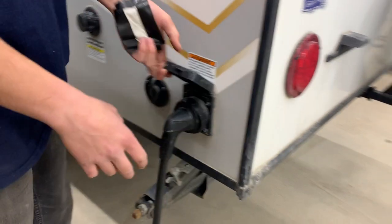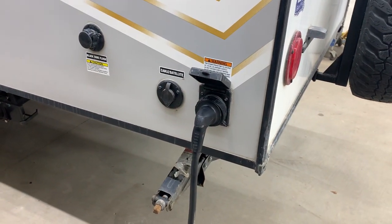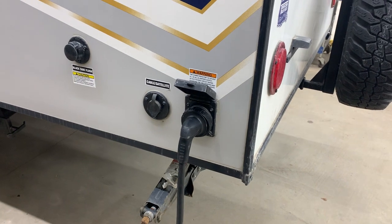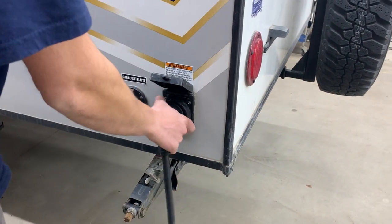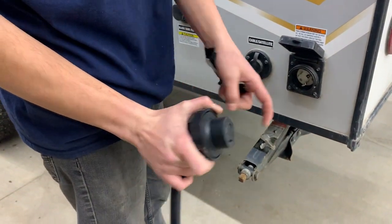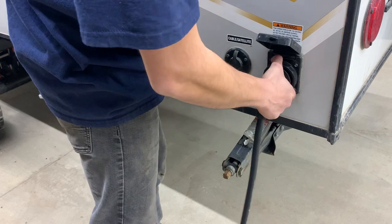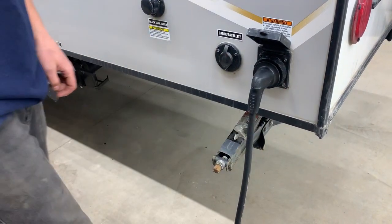In the far left back corner, you will find your power cord. You just got that twist lock — take note of that notch there, it lines up to this notch on the trailer side. Give it an eighth turn once you push it in, and then just the threaded collar to really lock it down.